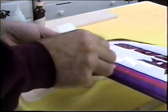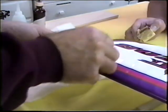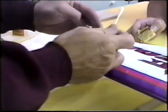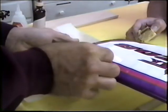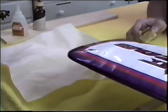Now, what about hard to soft? Well, we put the green stuff on. That'll take care of that. Where you are now, it's hard, but it's so thin, you're not going to get the oil can effect. If you were to make this hard, like where a cap strip ends, that's where it wants to crack. Oh, that's good. That's kicking off nice.